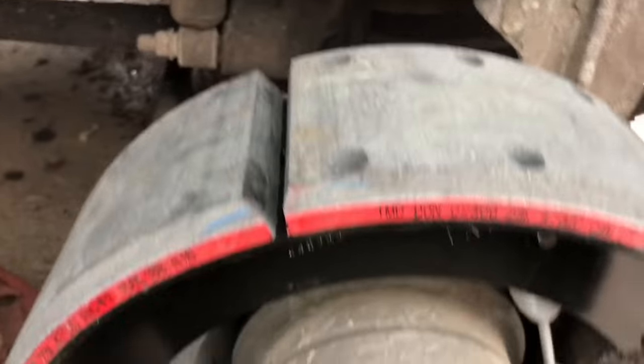The wheel's back on. What I do is guide myself from the valve stem up here, put it to the top. I go across in a cross pattern and hit them twice, then rev up the motor on the truck all the way. Preferably you have a shop compressor, but you can still use the air off your own truck. I go across each way and go around it twice. You need about 400 to 500 foot-pounds of torque — bottom them out and then hit them again about a half turn. I drive about a hundred thousand miles a year and use the air off my truck more than half the time.